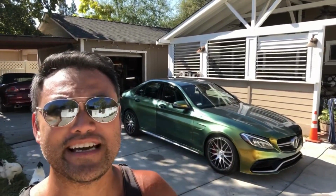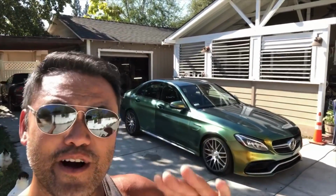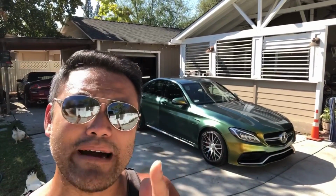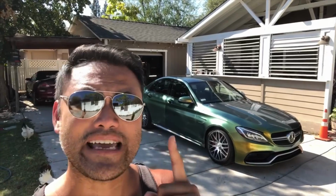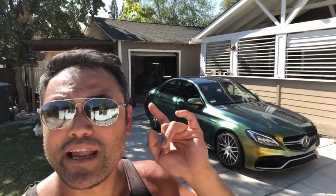Okay, so that's it for this video. I hope you guys enjoyed this episode. There's really a lot of complications when it comes to wrapping, especially other people's cars. And when you start to lose clear coat right in the middle of wrapping, that's when you're going to have real issues of losing big pieces like the bumper, quarter panel, stuff like that. On top of that, the people that own the car might not know that might be the case with their cars, so they might get mad at you for that. So make sure that you have everything documented, make sure you record everything, make sure you let them know right away when you see an issue and show them why and explain it to them in great detail, and just be real with them, just be true, and just tell them what their options are at that point in time.